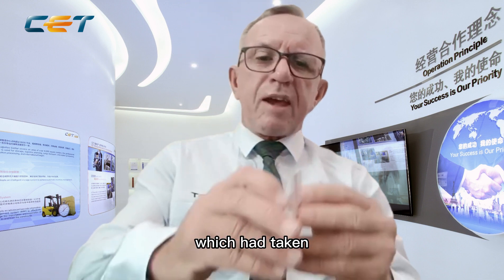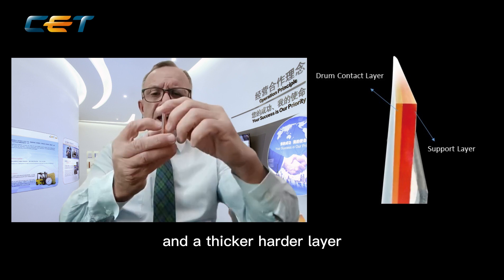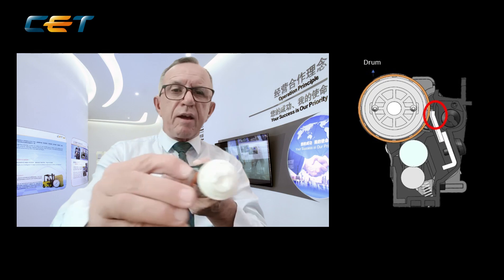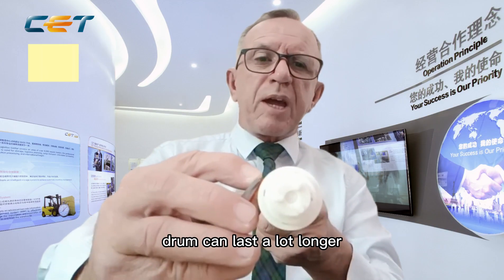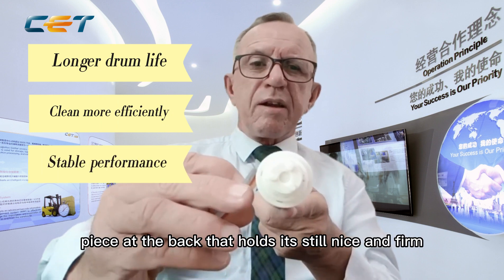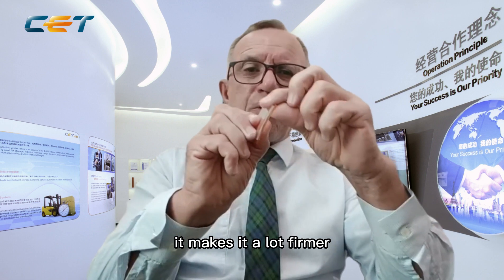The new technology uses two layers of polyurethane rubber: a thinner, softer layer and a thicker, harder layer. The thinner softer layer is the one that comes into contact with the OPC drum. The reason behind this is so that your OPC drum can last a lot longer — the softer surface cleans a lot more efficiently. The harder piece at the back holds it firmly against the OPC drum.